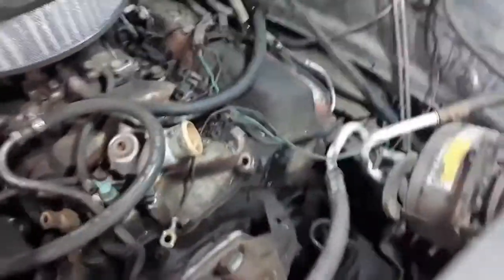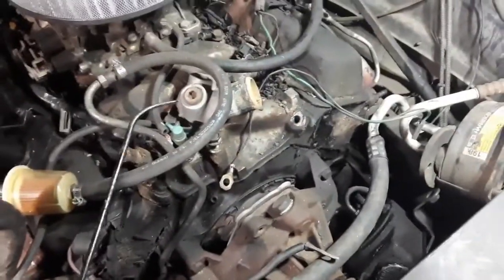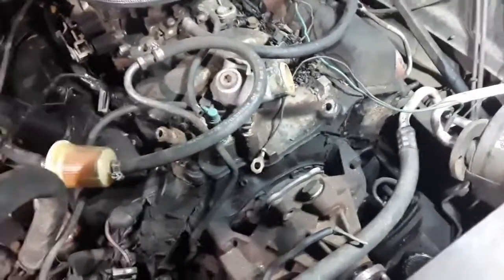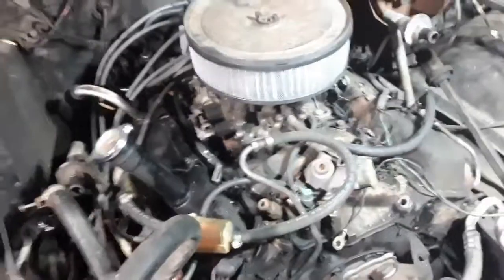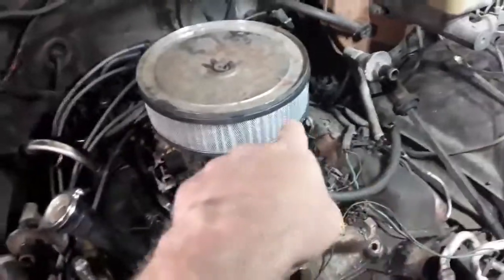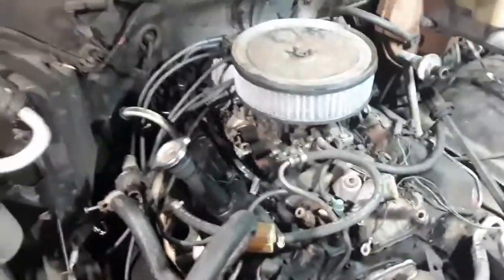What I've done is gone around with a pick and loosened up all the little bits around all my bolt holes. My next step is to vacuum the whole engine — I'm going to take a shop vac and suck all that nasty stuff off my intake before I even loosen any of the bolts, so I don't have to worry about any of that stuff falling down in there.